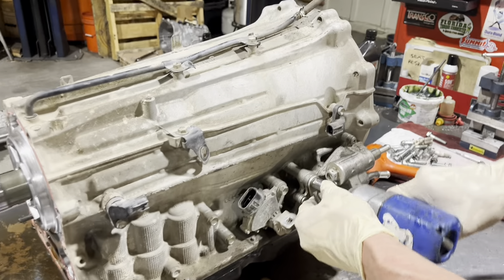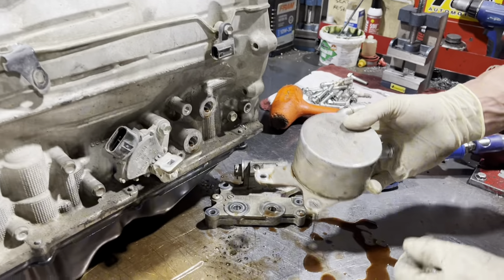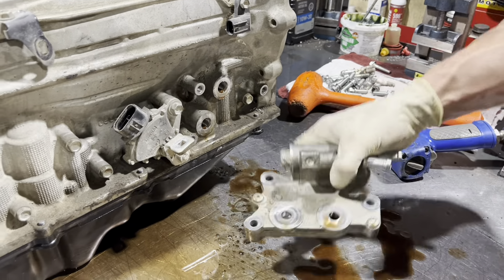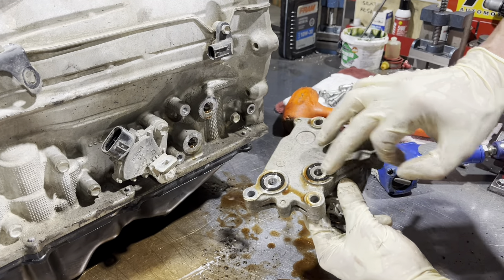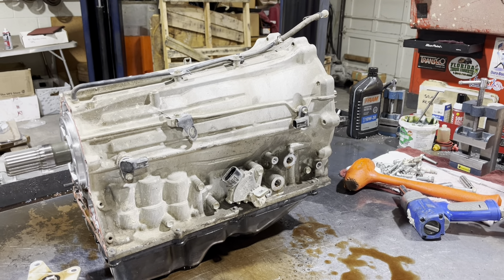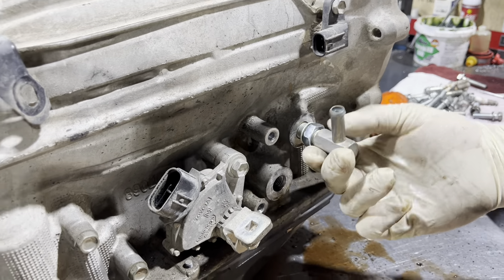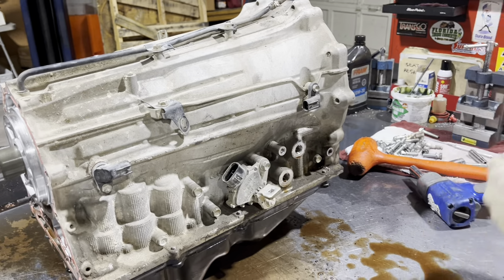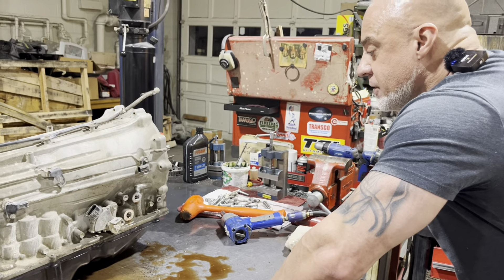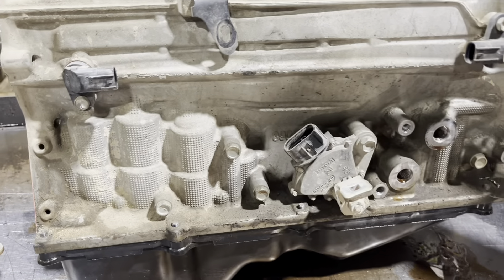These two pieces contain antifreeze. If you're changing these, there are O-rings that come in your rebuild kit that squash down onto here, and on the other side there are more O-rings that squash between the surfaces. These things are also threaded. I was also asked to see if I could find some AN fittings that are going to fit in here and work correctly, so if I can I'm going to put those part numbers in too, because a lot of you guys at this point have braided lines. The manual lever switch we've discussed in other videos - I'm probably just going to leave it here.